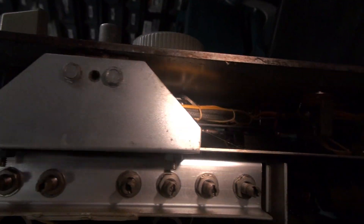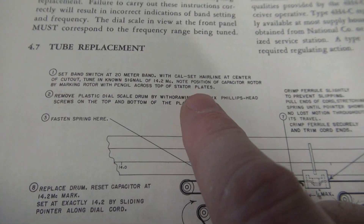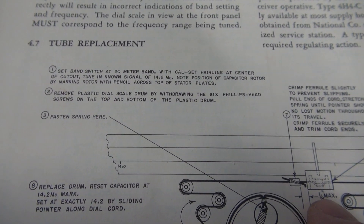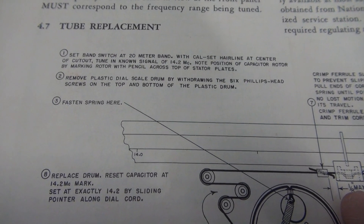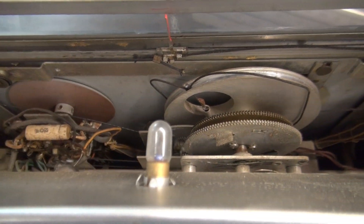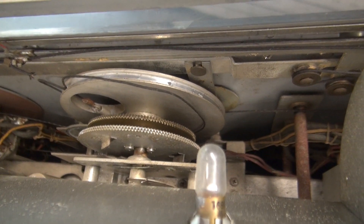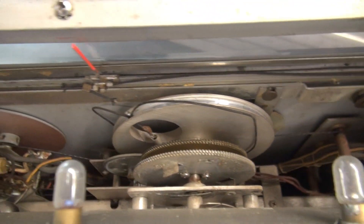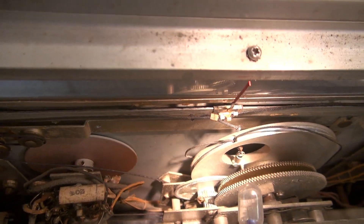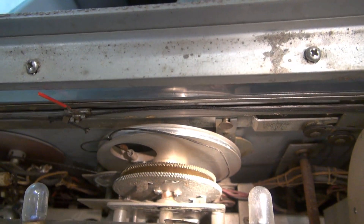The cord's not on it. I can't tell if it's broken yet. According to the manual, you should be able to change this cord without pulling the front panel. We'll give it a shot — I have my doubts. There it is. I do have access. Maybe if I'm careful with some tweezers, I might be able to fish it around that front pulley. The good news is it doesn't look like the cord broke — it looks like it just popped off this pulley.